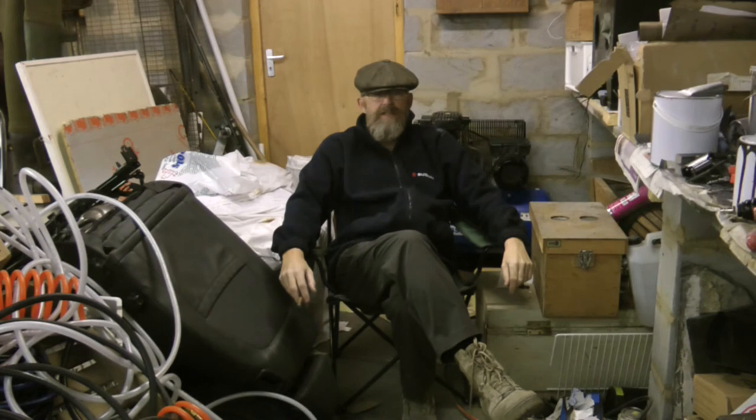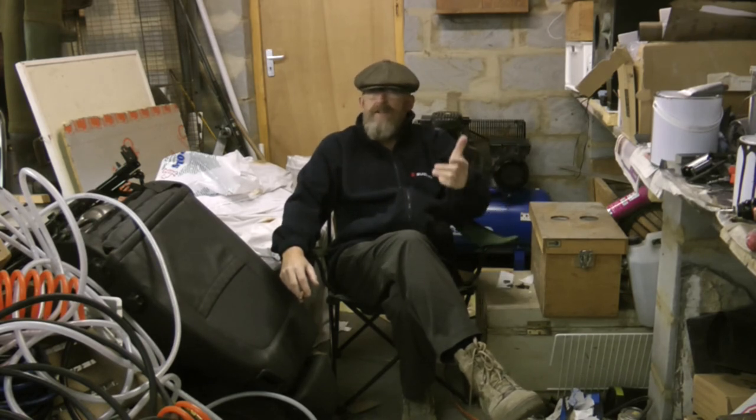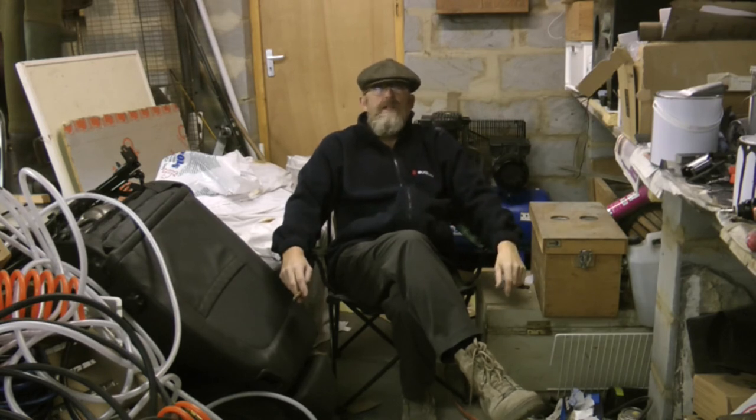And there was a tendency, I think, I was using the trigger on the gun as a switch. It was on or it was off. What I've done now is I feathered the trigger much more to moderate the delivery of paint. I wound the pressure down a little bit.